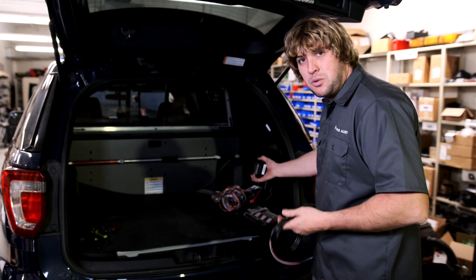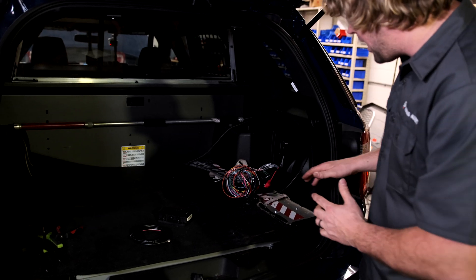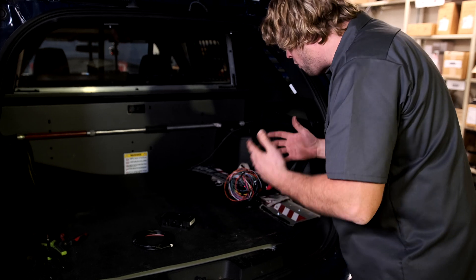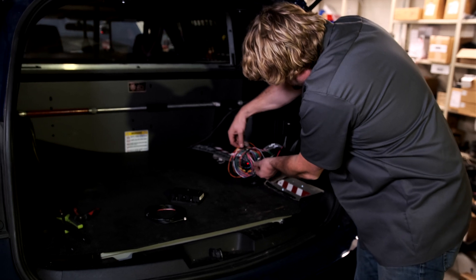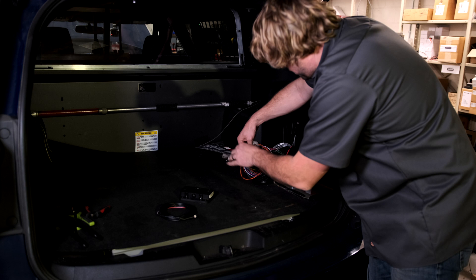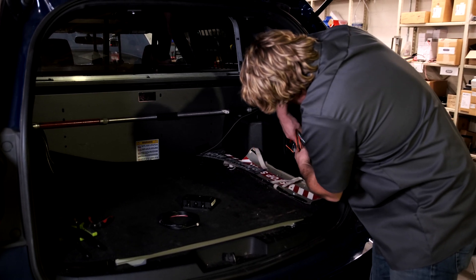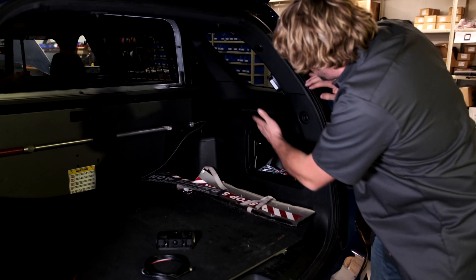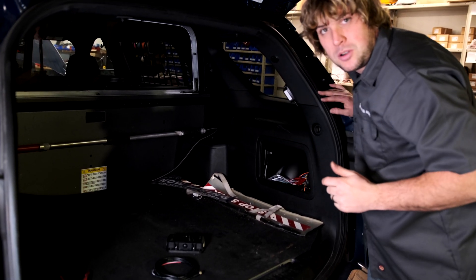On this vehicle, I'll show you real quick how we installed it. This is a SoundOff blueprint system, kind of like a multiplex electronic system, but this can be one way that vehicles are set up. Other vehicles are set up with relays and switches, but overall the principle remains the same: power, ground, and switched. On this vehicle, they programmed us a constant power, they programmed us a switched wire that comes on in both modes — rear and forward and rear. And then we grabbed our ground right here off the bus bar. This piece lives back here in this compartment, so this is just an auxiliary node for them. It gets covered, so all the wiring is nice and clean. The device is sitting up here and we've checked it to make sure that the light goes from green to amber when they turn the emergency lights on.